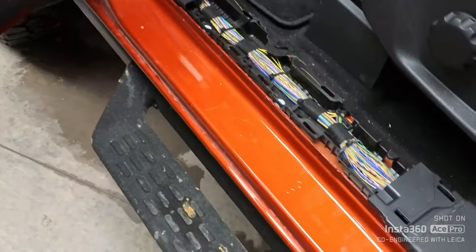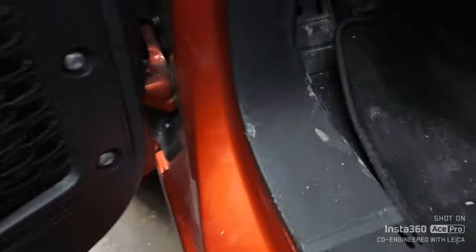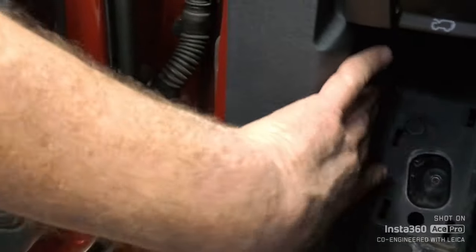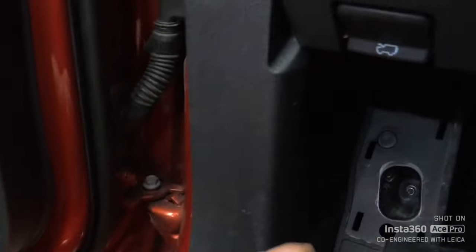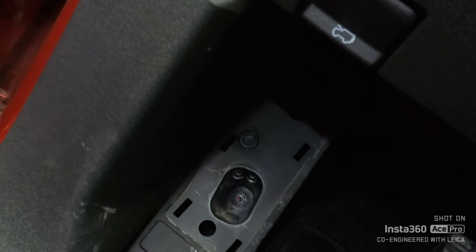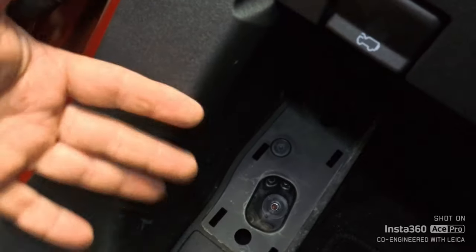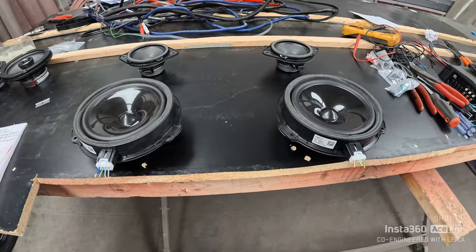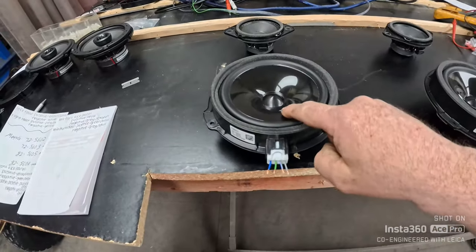Cam's working on that passenger side kick panel speaker. I'm going to work on tearing the driver's side apart. This side is a little different than the passenger side because you have this foot rest that is part of this kick panel in the corner. This panel pops off — see the clips behind it, just pop straight out. And behind there, looks like two 10 millimeter nuts that are holding that all together, so you have to get those two nuts off. Then this should slide out the same way the passenger side did. We got the speakers removed from the kick panel down by your foot, and these are out of the dash up by the windshield.